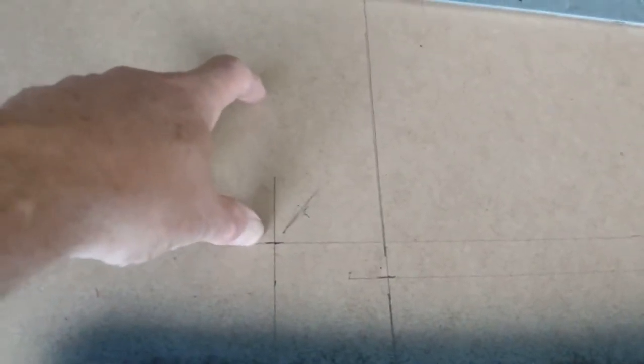So I can do that, and then I'll drill holes here. There's actually a pair of holes to hold that reinforcing on and the bracket for the rear bumper. So I may just match both of those up. For now, I'll get my jigsaw out and I will cut along this line here, and that'll give me the profile for the back of the boot floor.